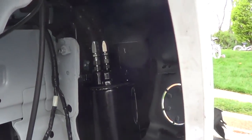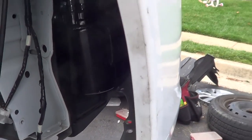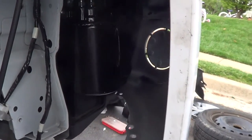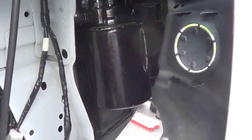The bypass is getting put in right here in the wheel well. I can reach up and change that out. That's only going to be changed every 25,000 miles. So it's a much bigger filter — this is a 2 micron filter — and it's actually going to be tapping right off of the oil pressure sensor.